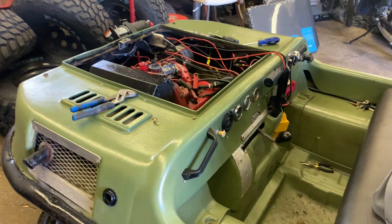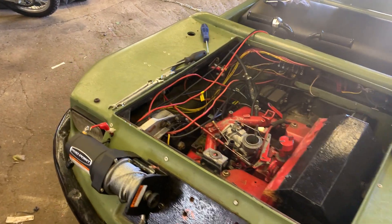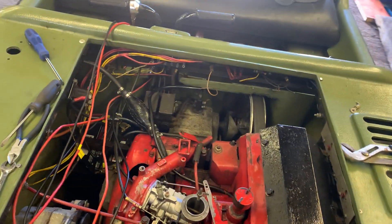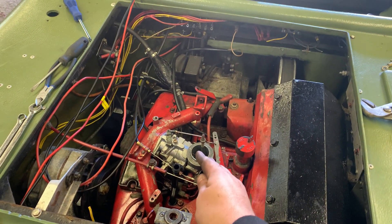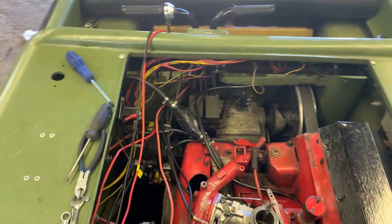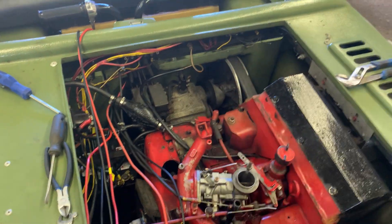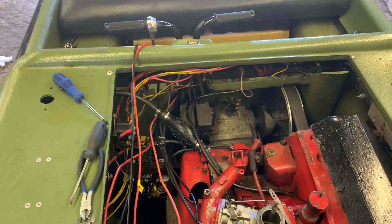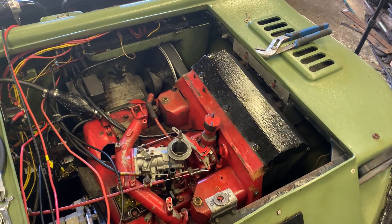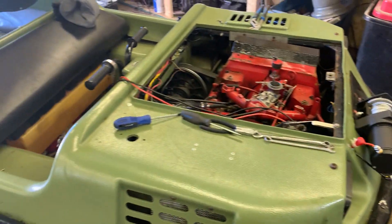Looks like we got her done. She's running way better and starting right away every time now. Before it was taking forever to start and it was being really difficult. I've got to put some return springs on, I've got to set the idle so she holds her idle - right now everything's kind of vibrating so the throttle is just vibrating a little bit open and closed, that's why she's a little bit lumpy. But if I had the springs on her she will hold steady. I'm going to put the shroud back on, put the air filter on, all that stuff a little bit after, because I kind of need to mess around here now with the electrical - as you can see it's a nightmare. But yeah guys, that's basically how to clean the carb - nothing to it at all. Take your time and get used to it, it's pretty simple. Thanks for watching, hopefully you enjoyed this small video, and time to crack on and get the next project done.